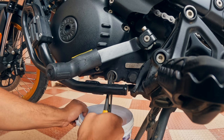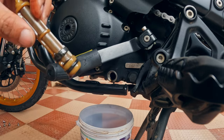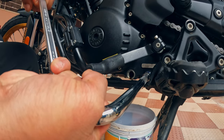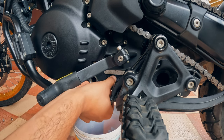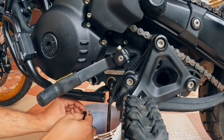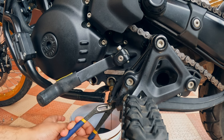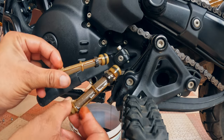There is an oil filter inside the drain bolt — use a pair of pliers and remove it by pulling it out. Similarly, there is another bolt and another filter on the other side, so we have to remove those as well. A lot of oil came from the second drain bolt and some got spilled, so keep a rag handy in case you need to clean your hands or any surface. Once the oil has drained, remove the second oil filter using pliers just like the first one. Both filters are exactly the same, so you need not track which one goes where — you can put them back in any order.